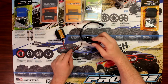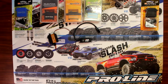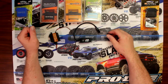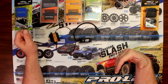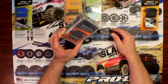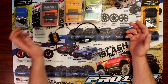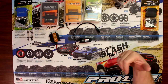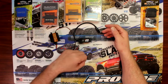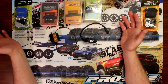This is the 1256TG with titanium gears — a great servo. Make sure for your application that you grab the correct servo. You could go overboard. For example, 166 ounces of torque is great for a short course truck like my SCTE — the vehicle isn't heavy and I'm not climbing rocks, just on dirt roads. You could go with 277 ounces of torque like this one or this one, and you'll be fine too — no problem.